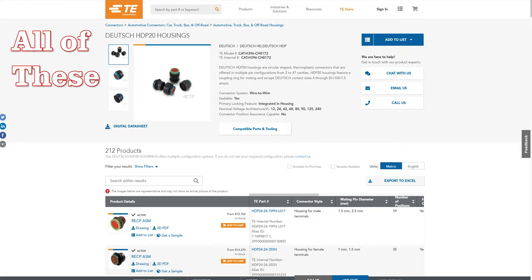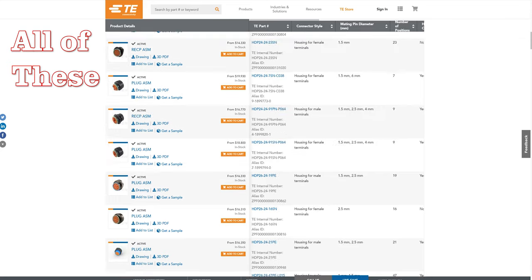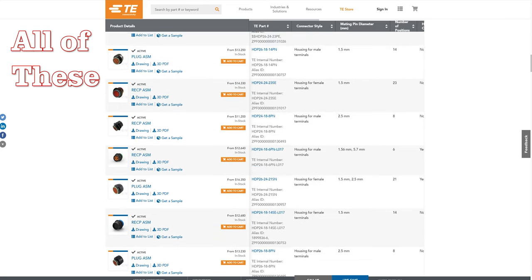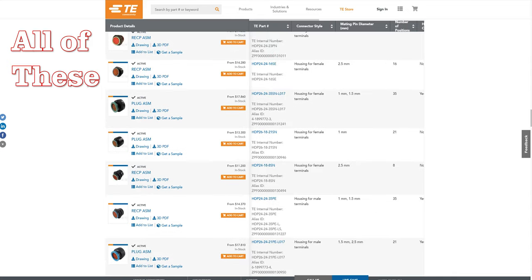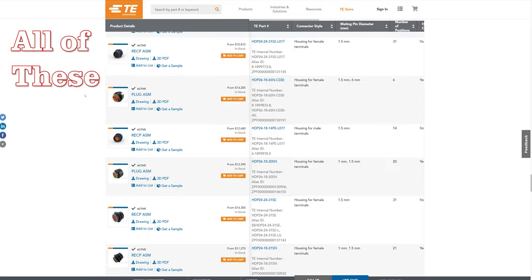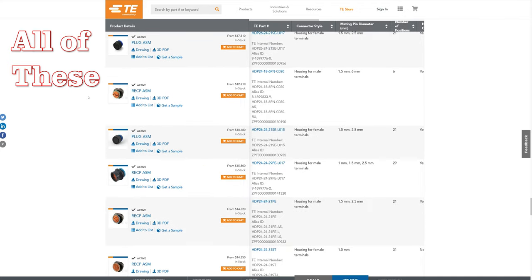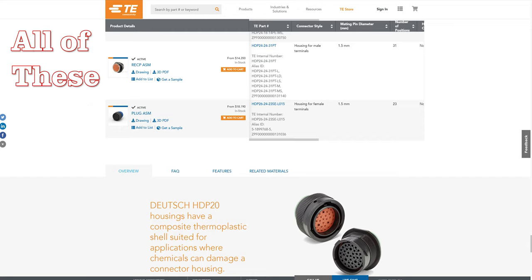This gives me a really highly serviceable setup and a sealed design. I don't have any place with a grommet hole that's a little too big allowing air, hot air, water, and noise to pass through the firewall — I've got a sealed connection, nice and tidy on that firewall. There are a lot of bulkhead connector options: some have tons of tiny 22-gauge wires, which might be good for ECM or engine harness setups. Others have larger wires — the ones I primarily use have 12-gauge terminal size, really good for headlights, turn signals, and slightly larger loads.